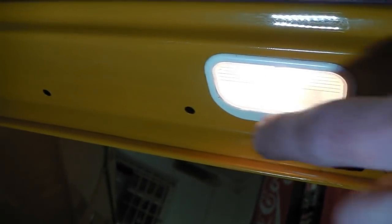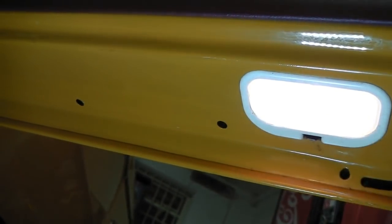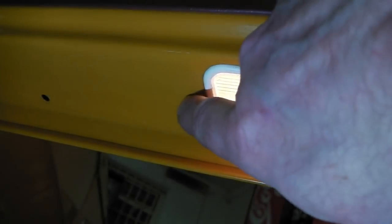And this is where we'll be letting our oil seep in. Okay, this is a notorious line for going. How long mine lasts over the years, I don't know. I'm missing a rubber strip as well. It's a sort of air draft strip. I need to fit that. The reason I didn't do it is because it crossed across my puddle light here. I've got a puddle light there. So I need to make a shorter strip. I'll do that. I forgot about that. That just plugs into those holes. That's a draft excluder. It basically stops wind noise and also stops your sills drawing dirt in. You can get that a lot on your steps.